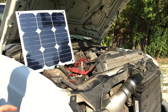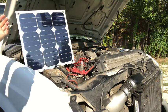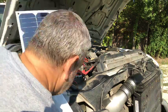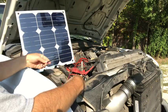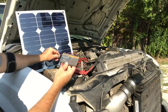So I was just looking at the comments. JC Smith said that the 9.5 volts doesn't seem right. I agree with that. Normally at rest on an uncharged battery, you'll see 11 volts or something like that. So let me double check it again. We saw what it was with it disconnected. Now let me check it with it connected.